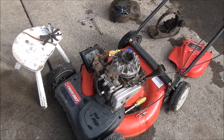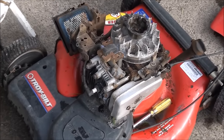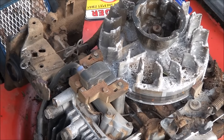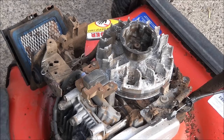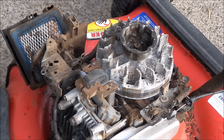I want to give you a bird's-eye view of how to gap a Briggs & Stratton lawn mower coil. It's really easy — you can see some of my other videos on how to take the engine shroud off. Once you get to this point, you're going to need a quarter-inch socket (some have a 5/16ths), a feeler gauge, and more specifically a number 12 feeler gauge.